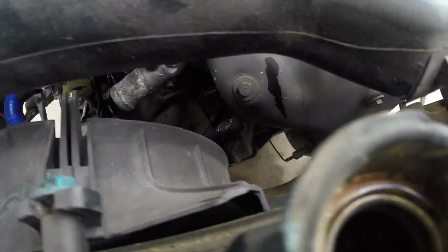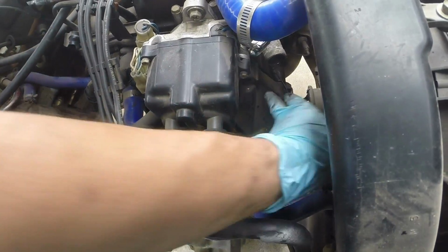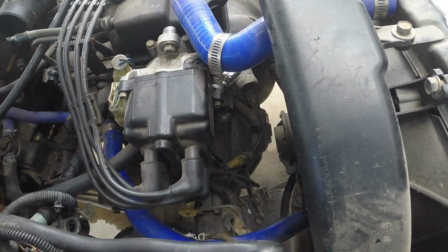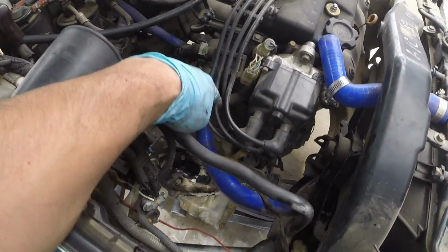There it is. Got it lined up. You can see it's pushed on. And that was the hardest part, is getting it just lined up, and I ended up kicking it just to shove it on a little bit. Now I'm gonna put a bolt here at the top and pull it on. That way the transmission is secure to the body. I put on this bolt and the other bolt, the top 2 for the transmission. Now what I'm gonna do is raise it.